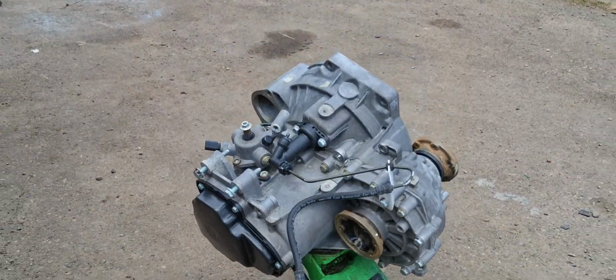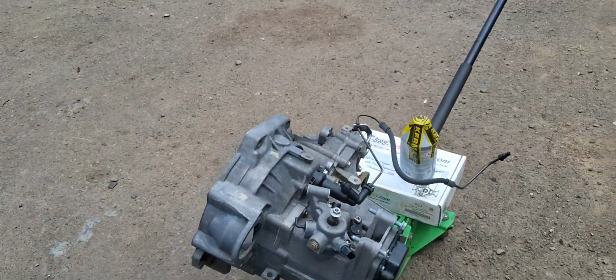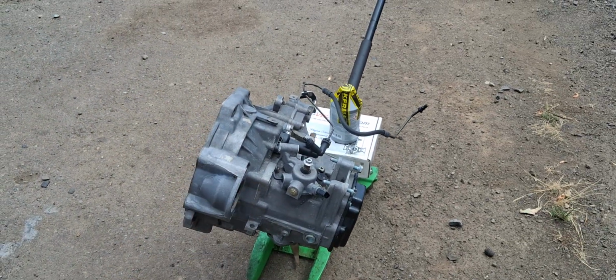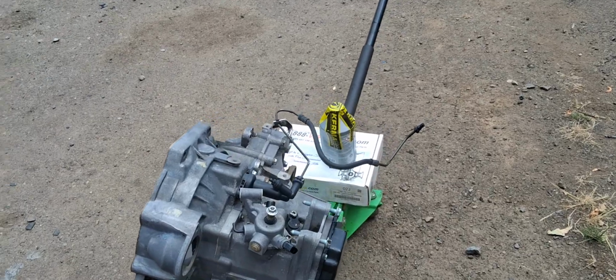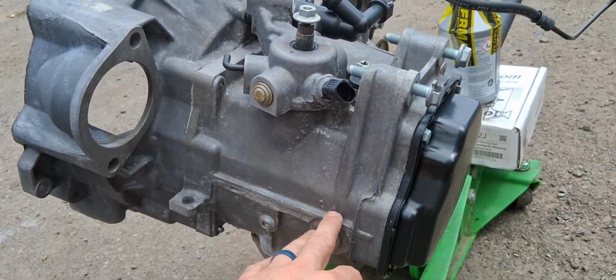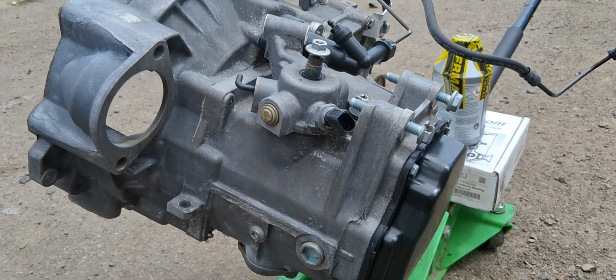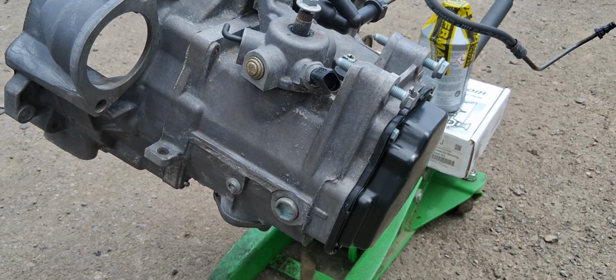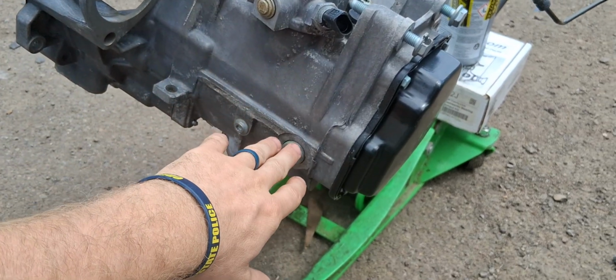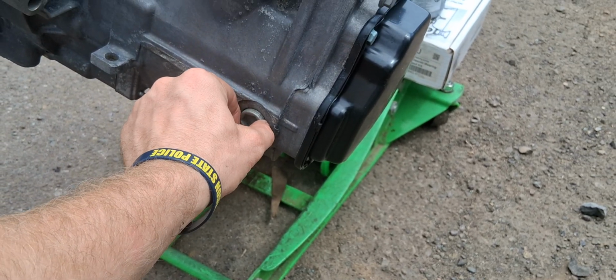The only thing that worries me, something you need to consider, even if you've taken care of your car, had it dealer serviced since day one, the concerning point is Volkswagen describes the fluid in this transmission to be lifelong, which means supposedly it doesn't ever have to be changed. Now, if it doesn't have to be changed, that means somebody really wouldn't check it. I recommend checking the fluid in these transmissions.